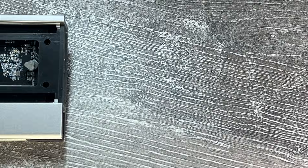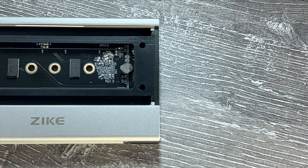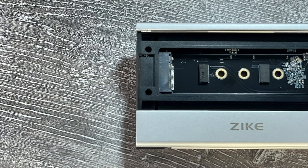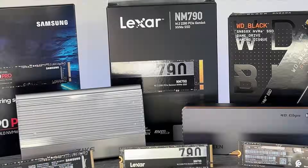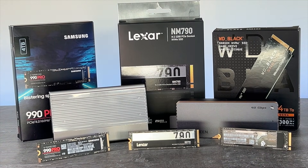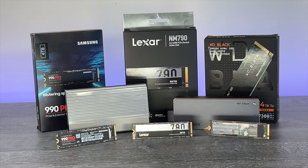The Zike unit is bigger but it's also silent. The question is whether it can keep the SSD cool enough to prevent throttling. This unit again uses the same ASMedia chipset so we should expect similar peak performance, however peak performance isn't all that matters. Different SSDs have different performance characteristics based on the type of cache they use and how much there is of it. There is also always the question of thermal management as SSDs can get really hot and they typically throttle once a threshold is met, which can significantly hinder their I/O performance.